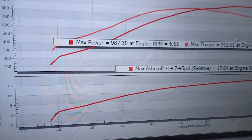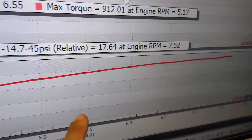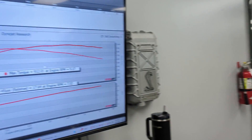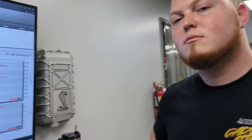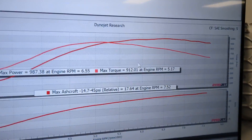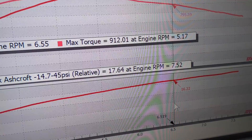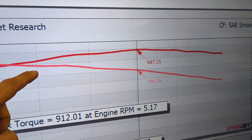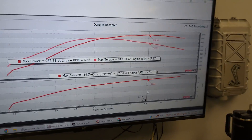987, 912 — showing a peak of 17 PSI, but it looks like we're getting a little bit of boost creep, or boost is rising with RPM. Maybe that's the intake, who knows. If you look at peak power at 6,500, it's really making closer to 16 PSI, and that's probably about where we're hoping to see it just hold flat. So let's get the intake on and see what happens.